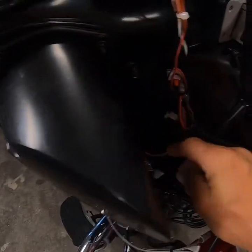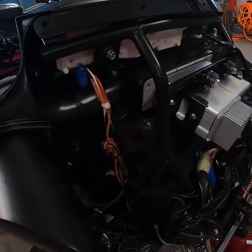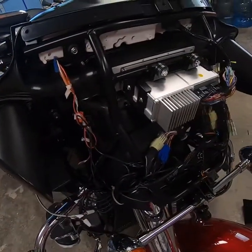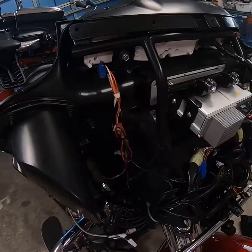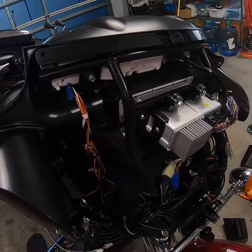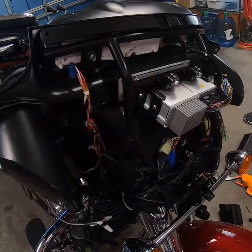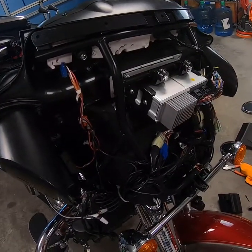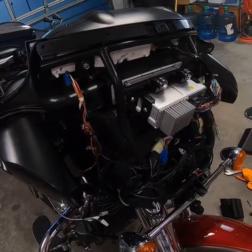I've come off the cigarette lighter right here and tapped in a wire, so I've got key-on power going up to my LED switch. My LEDs run off the cigarette lighter — I don't use the lighter anyway but it makes a good key-on source, so I've got a positive and negative coming off of that. I did my cameras underneath the seat before pulling the fairing off, but realistically if you've got it apart anyway, get your camera system in. I'm going to do another video showing how to get the gas tank off. For an extra 20 minutes, pull the gas tank and fairing off, run all your wires, and you'll get a much nicer, cleaner look.